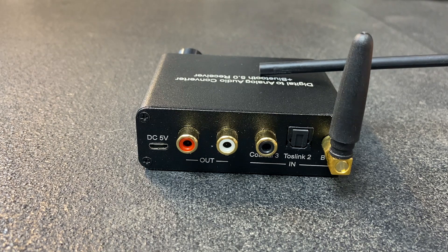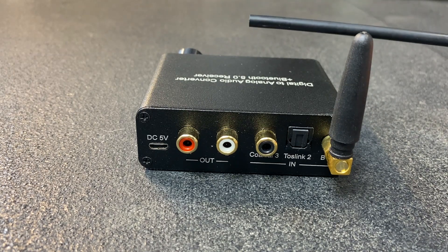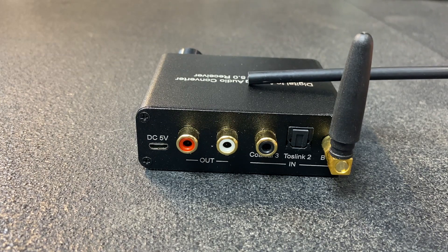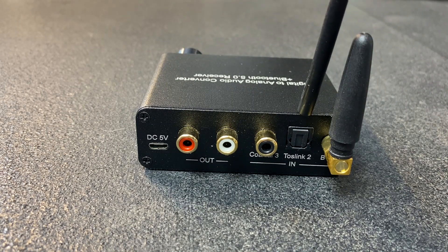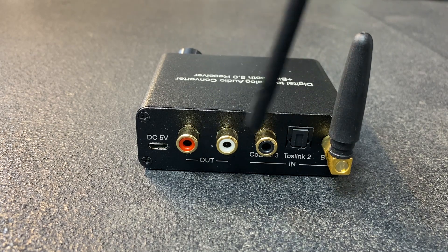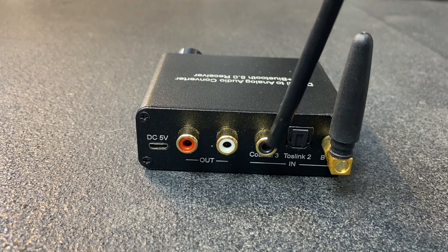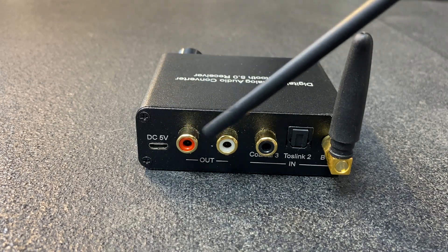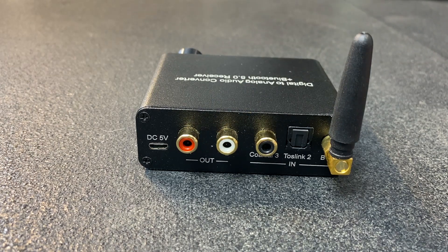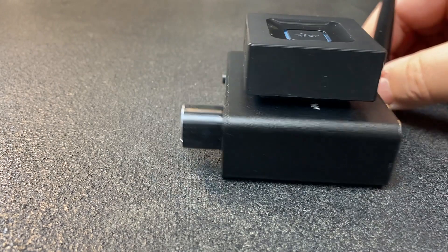The audio quality of this is exceptional. It has great left-to-right separation — not the mixed-in soundstage like the Logitech. I get really good range, almost whole-house range with this. At $30, this has a heck of a Bluetooth receiver in it. I also like that you could use this to act as a handshake between your TV and an old vintage home stereo. On the DAC side, if you have a CD player, TV, or even a VCR with coaxial audio output, you can plug it in here and output analog signals to your home stereo. It's a pretty nice-sounding unit and I think it wins on sound quality between the two. It's more feature-packed, though it is not perfect.